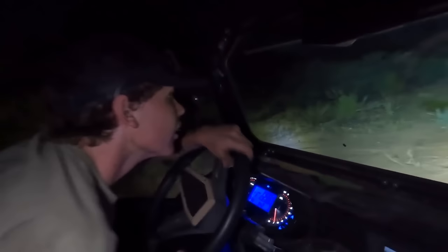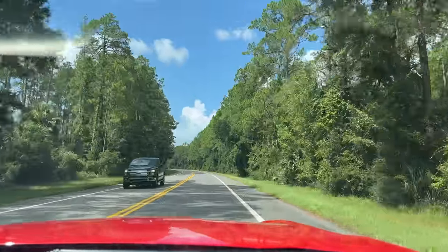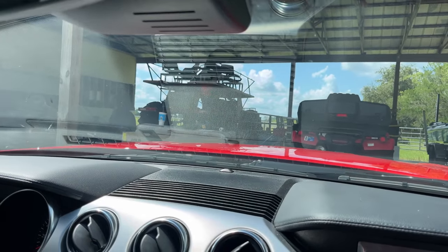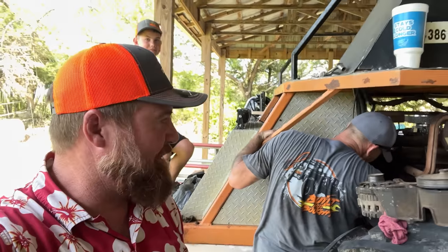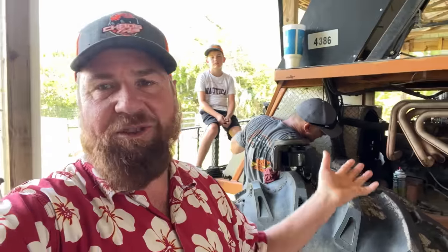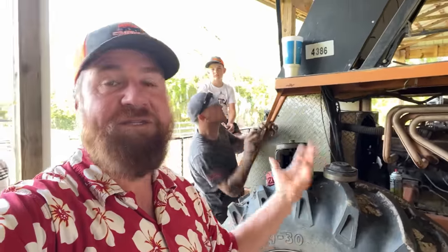Good morning, it is another day in sunny central Florida. We're going to be taking some swamp buggy rides, but first it needs maintenance and repairs. We got Colin here driving the rental Mustang, we got Rhett in the back, and we got Presley back here. We're going to go have some fun today in the swamps working on the swamp buggy. We got here and Paul's about got this under control — what he's doing is putting a serpentine belt system on this swamp buggy. They've had trouble with it throwing belts, overheating, not charging, and not steering — all the problems. Paul's solving them.